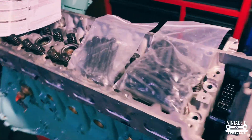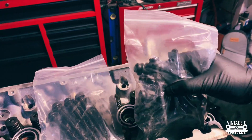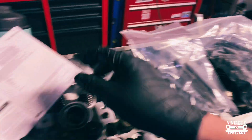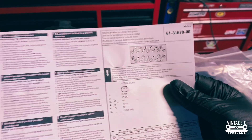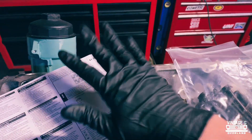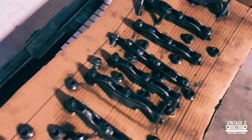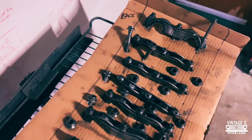We got the head back on. We've got our bolts from Ben's Force — these will replace all my head studs. We also have the torque sequence that came with the gasket kit. This is pretty valuable information. We've got the torque specs right there. And over here, this is all of the bolts that were taken out originally, and I put them all into this little cardboard plate.